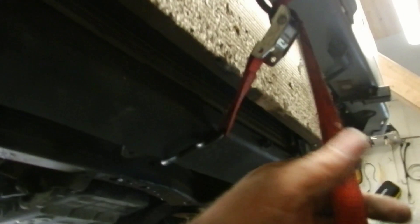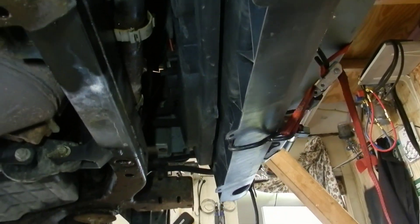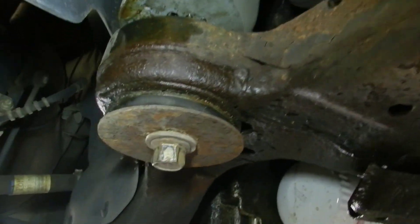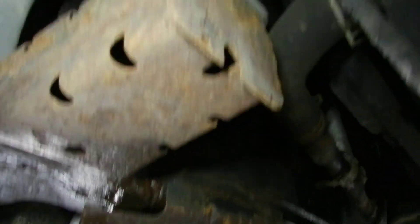Here's the receiver dryer — you can see I've got the front bumper pulled off. There's a giant core support right here that goes all the way up and all the way across, with bolts on top and on both sides, plus two bolts on the front. I pull the bumper off, take all those bolts loose, then take a strap to hold it so I have this large gap. The reason for that large gap is because the compressor — see it right there — is right there, and I need to be able to squeeze it through this hole.